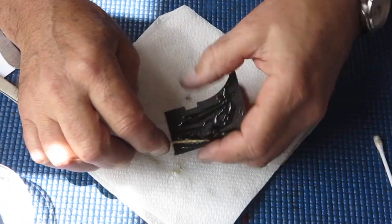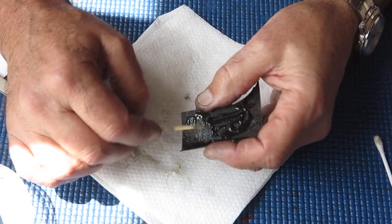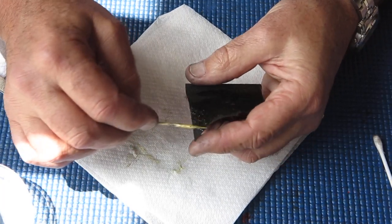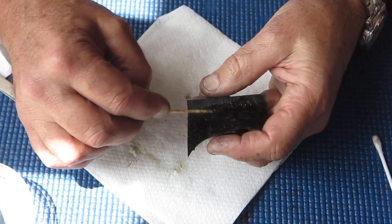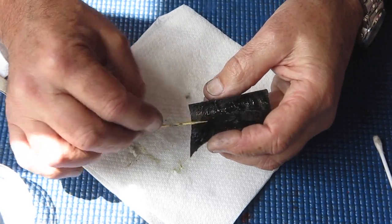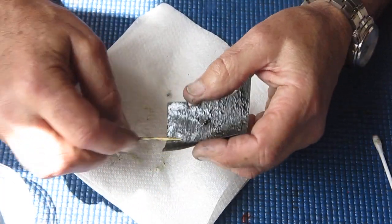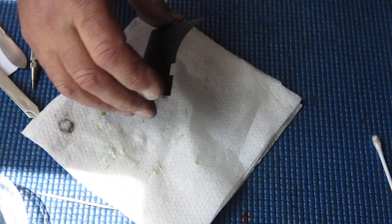Prior to attaching the leatherettes, I've cleaned all the body where this is to go and wiped it down with cigarette lighter fluid, naphtha, to remove any traces of grease that I'd managed to leave on there while I was servicing the camera, because I can leave greasy fingerprints absolutely anywhere.